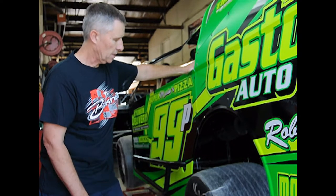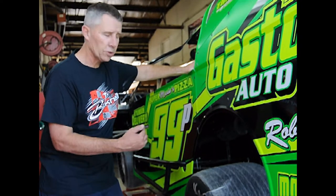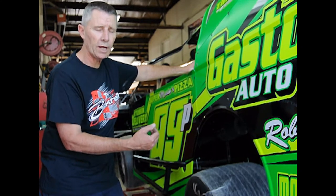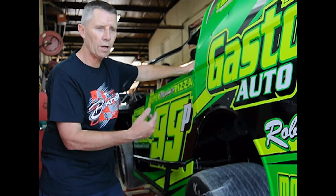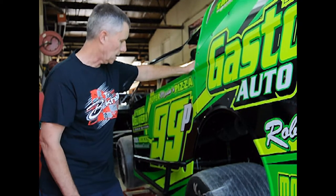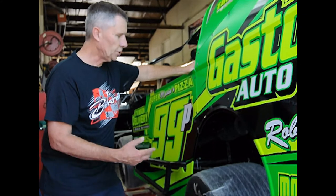With those wheel sizes, if you measure the offset of your rear end, you should have a 4-inch offset on the back end. You can measure that between the centerline of the rear end housing to the inside tire sidewall on both sides — naturally you want 8 inches greater on the right rear, and you're allowed up to 8.5 inches, but no more than that.